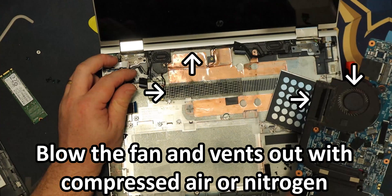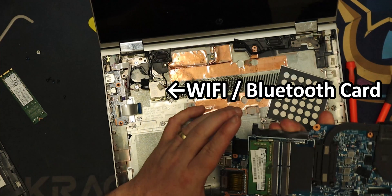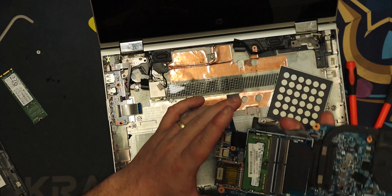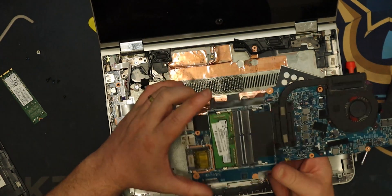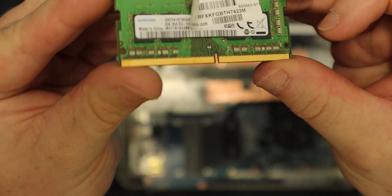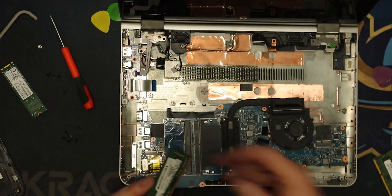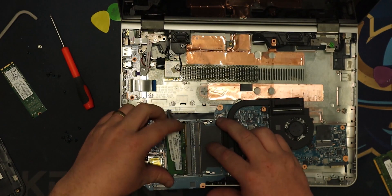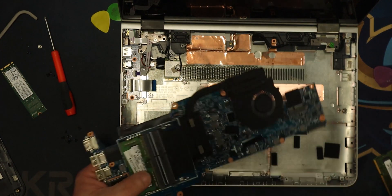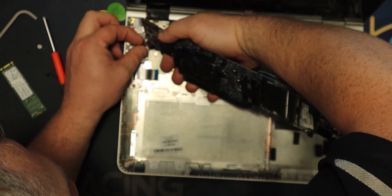You want to blow out all of these vents — make sure you get them really well. Compressed air works fine; you can also use nitrogen or argon if you've got some. We've got our Wi-Fi/Bluetooth card there — I didn't remove that for this video. There are two RAM slots. I was planning on doing a RAM upgrade, however this is PC4L (DDR4) and I only had PC3L RAM, so we gave that one a miss. But you could upgrade these if you wanted to — this one had 8 GB of RAM and you could put another 4 or 8 GB stick in there.